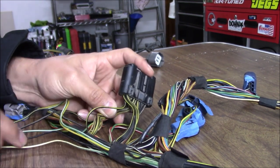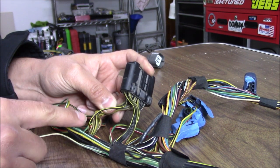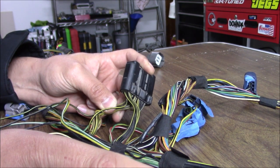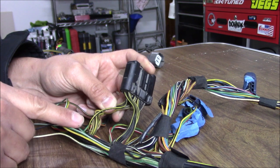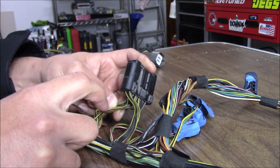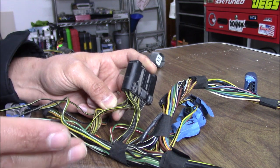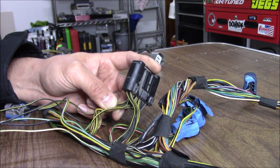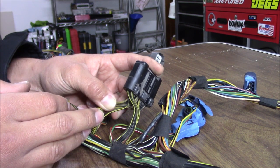What I'm going to be doing is just taking one wire at a time, cutting it, then running a new length of wire from the cut end and pulling it all the way back to the ECU connectors. I'll get the length of wire I need, then solder one end and solder back to the other end of the cut wire. When I cut them they're split, the new wire is in the center, and then I can pull it. It sounds a little confusing but when I do it you'll understand.